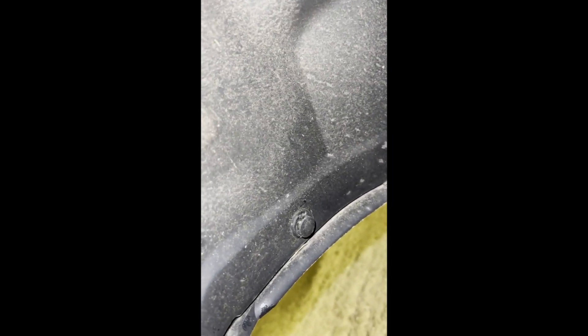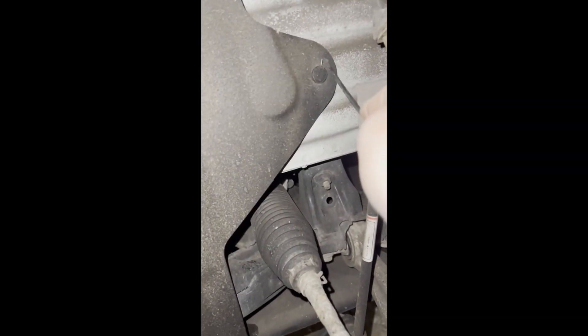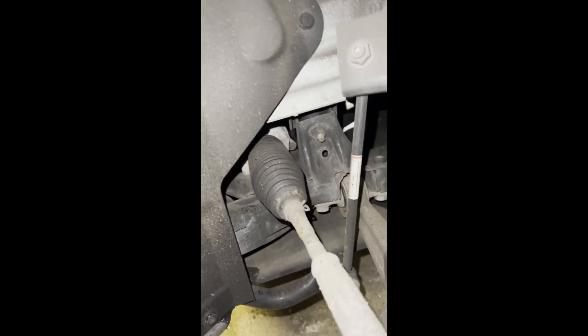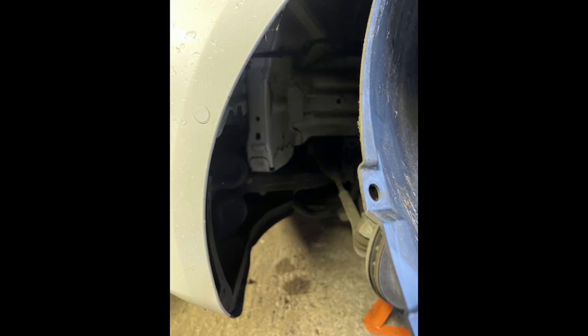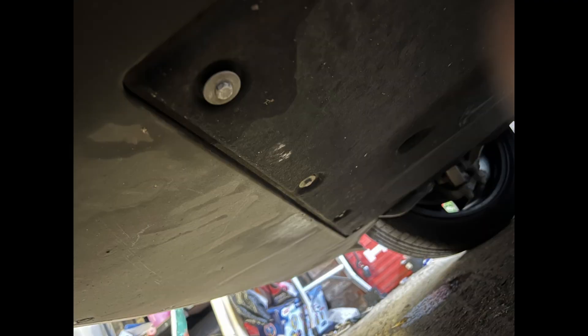You only need to do the front clips, because you can move the front part of the mudguard out of the way to get access behind the bumper. The next step is to loosen the tray under the bumper — it's attached at the corner with a 10mm nut on a stud, and there are further 10mm fasteners going across the bumper edge underneath the car.